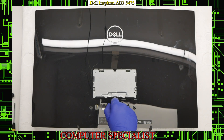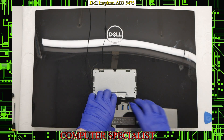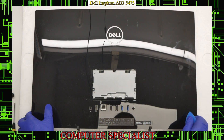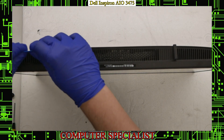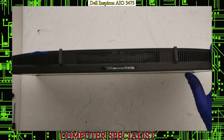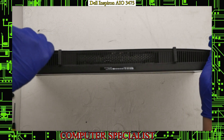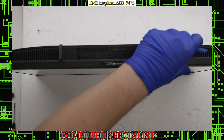In this case we have a little USB extender, so we'll remove that. Now take your pry tool, guitar pick, or whatever you have, and separate the two back pieces — you can kind of lift up and see it coming off. Since the latches are on the sides, flip it over and work your pry tool around the machine to separate the clips. You'll hear them start to detach as you work your way around.